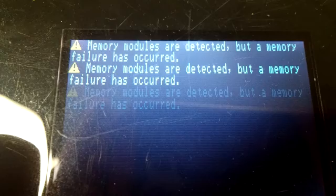If they deliver it to you and it works, we're all good. It was sent, I put it in my computer, and it worked. I had a little bit of issues because I had to figure out about the RAM going into the white and the black slots. You have to make sure you get a pack of two for each color. Remember, this is dual-channel memory. If you buy two packs, one pack goes in the black slots and one pack goes in the white slots — they alternate black, white, black, white.